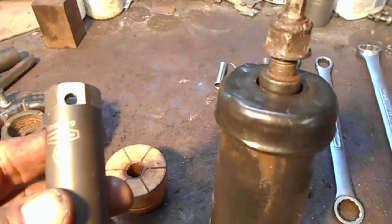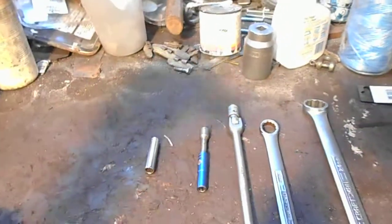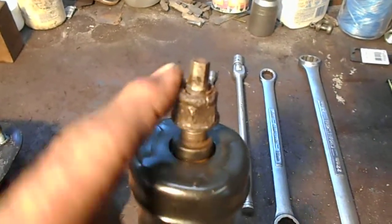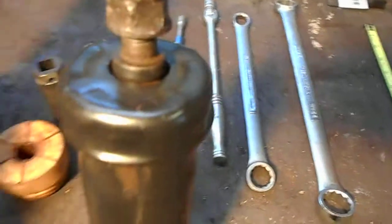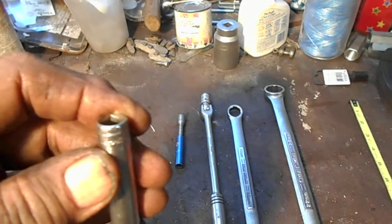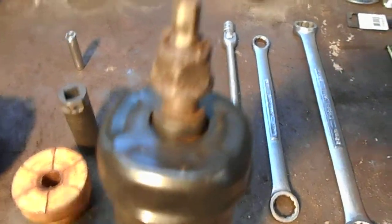What I had made — and it worked out fabulous — because at the time of the other video, I had not actually got the part successfully off. I took an 18mm socket and impact, which is the correct one for the top of the strut nut. The top hex up here is listed as 8mm, but because it had lost a little bit of meat due to oxidization, when I put the 8mm on, it worked for a while and then it started getting tough. So I ended up refiling it to 9/32.